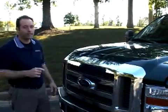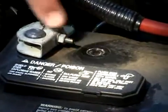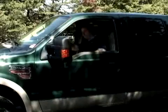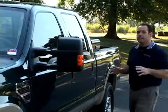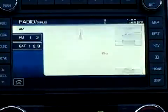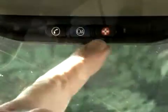Before starting and during the reprogramming process, it is important that the voltage in the electrical system remain constant. To ensure this, you should have a fully charged battery with clean terminals. You will need to turn off radios, GPS devices, radar detectors, etc. You should also make sure the headlights and dome lights remain off during reprogramming by keeping the doors closed and setting the parking brake to disable any parking lights that may come on when you turn the key on. All these things can drain the battery voltage or even cause electrical interference that could disturb the reprogramming in the ECU. If your vehicle is equipped with satellite radio or you have a Chevy or GMC with an OnStar system, you must temporarily disable the system before programming by removing the fuses associated with these systems. Refer to your owner's manual for the correct fuses.